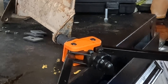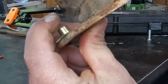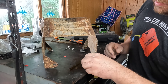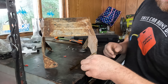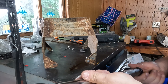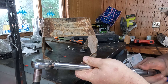If you guys can see that, it is actually in there. If you look on the other side, it is squished down and that thing isn't coming out. Then you can just go ahead, take your bolt and thread it in there. We'll actually torque it down to kind of see what it torques to. So we got this little Harbor Freight torque wrench and we will go ahead and put it up to — let's say 50 foot pounds — and see how that works.